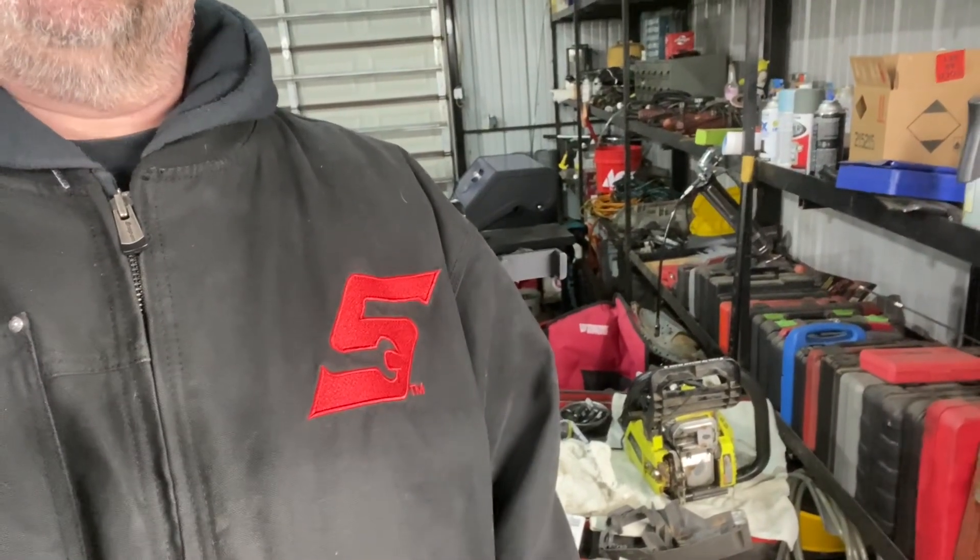To conclude this video: I don't know what's going on with this chainsaw. I replaced the carburetor, new spark plug, everything, and it's still losing fuel. You can see in the video where it lit up for a bit, gave it some gas, worked for a second, then just died off. I checked the exhaust and it's not clogged, so that's ruled out. If you have any other ideas, let me know in the comments. Thanks for watching — if you liked the video leave a like, leave a comment, and if you haven't subscribed, subscribe. I appreciate you all watching, and I look forward to seeing you in further ones. Until next time!